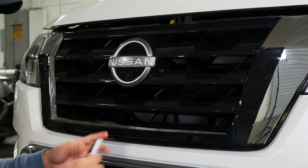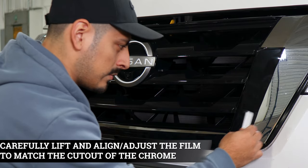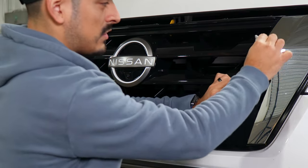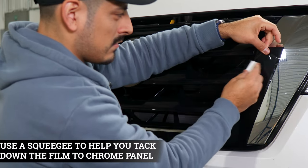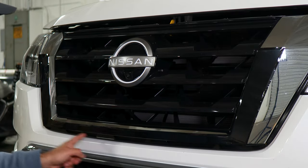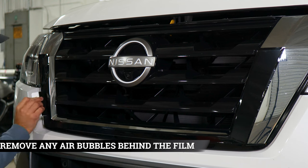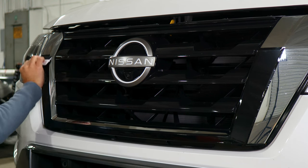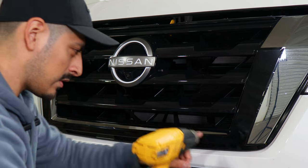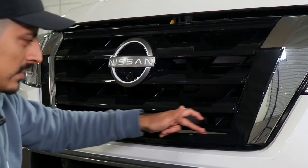Once you place the film and it's aligned, now we can start tacking it down. If you need to lift it to remove any fingers in order to avoid creasing it, you can — just make sure you place it back down and don't accidentally misalign it. For this one just make sure this section is covered. You can always lift it, hold it, and squeegee it to tack it down. Finish off everything, remove all the air, and then we'll come back and seal the edges by applying heat. Now all we need to do is apply heat to seal all of the edges. Just be careful not to crease the film if you do have any fingers — work those fingers down, and then once we seal all of this we can move on to the middle piece.